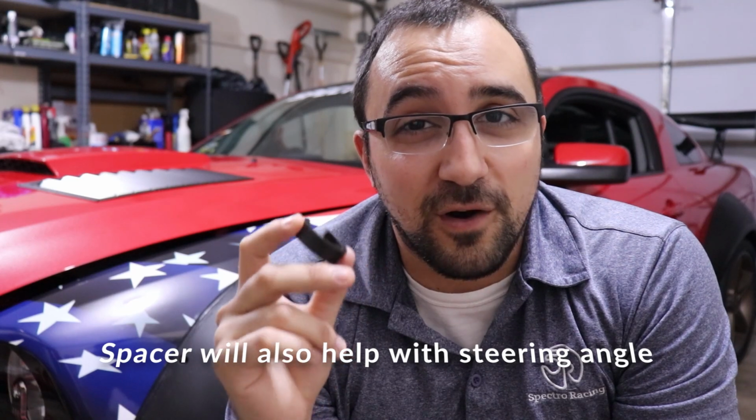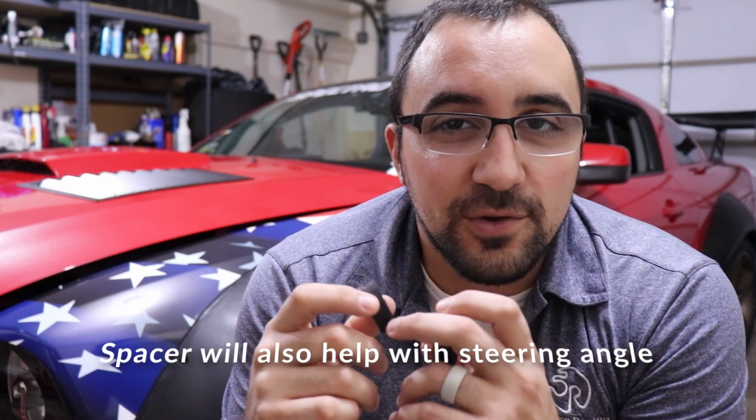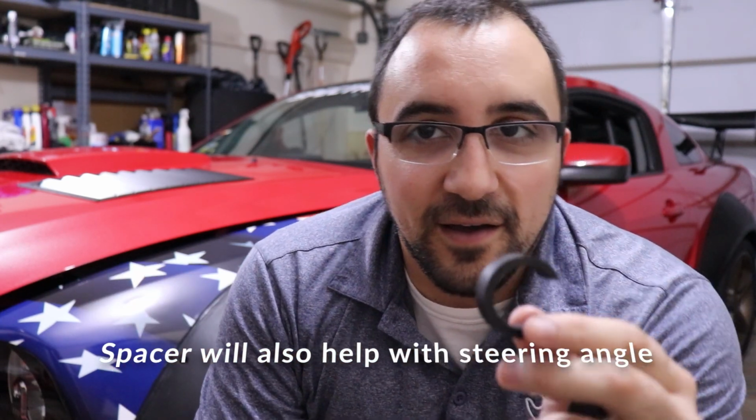So one of the other things I did is I removed the steering rack limiters. Now there's a great video by Chris Fixit about how to do this with his Mustang drift car, and if you're watching this and you don't have a Mustang, I'm pretty sure most cars have these in their power steering racks. All you have to do is get underneath the car, remove the boot, and there are these little plastic thingies on most cars where you can just remove them.